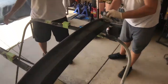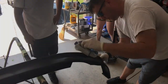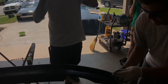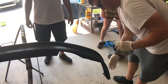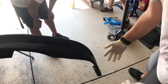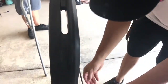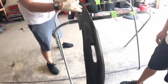This will pick up any type of dirt or grease. You see that little nick right there — stuff like that will show up in your paint. You didn't sand that down at home, did you? We'll put a lot of promoter on it, but you can see this is going to show up in your paint. It's all in the prep — that's where people mess up.